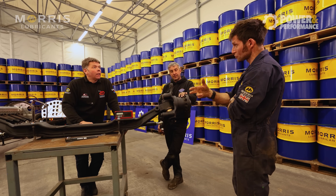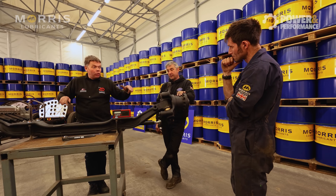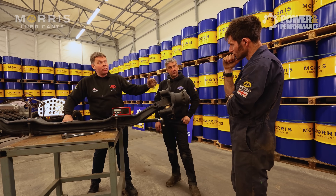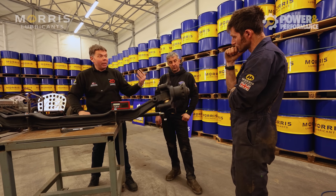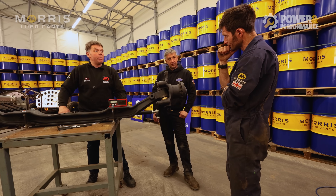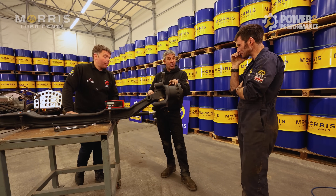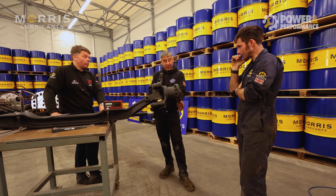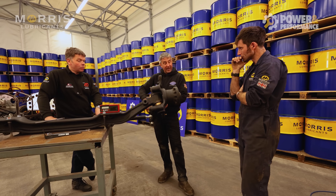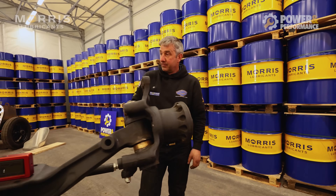So really this shouldn't be as good as it was then? No, but now we've put the three degrees in it. The whole reason we had the twist in it before was so that when you put a bit of lock on, you were getting camber change all the time. Now we've got some camber to start with, so we're hoping if we can find the sweet spot, it's going to be better than the old one. Dave's an absolute brainchild on the steering box on the truck. We've been on the front of the chassis now — we've moved it into the middle, crossways on. Redesigned the whole thing, re-engineered it all.